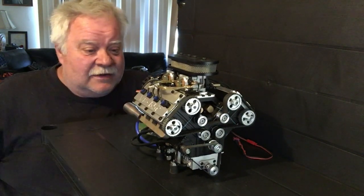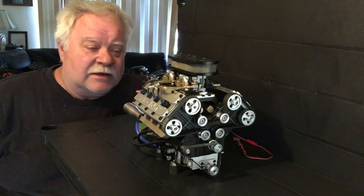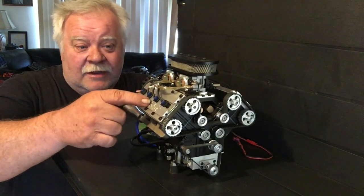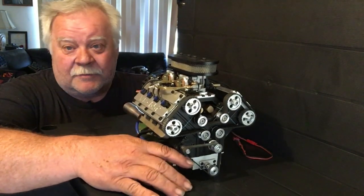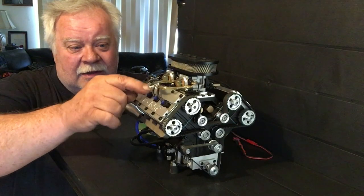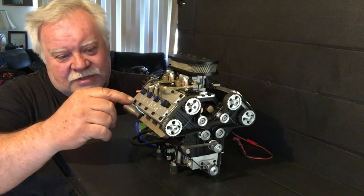This thing is just amazing. I spent over 50 hours on this thing this week — just playing with it, testing it, tearing it apart, looking inside it. It has fully true adjustable rocker arms and a complete fully wet sump oiling system that runs up and actually comes through the valve covers through these two little holes, individually oiling each and every rocker arm.